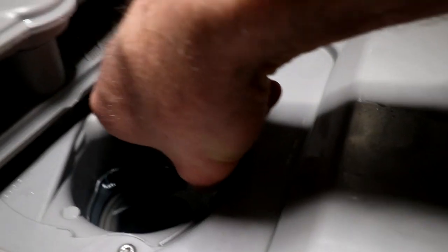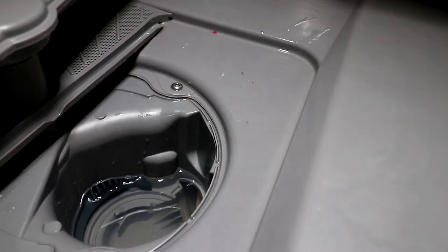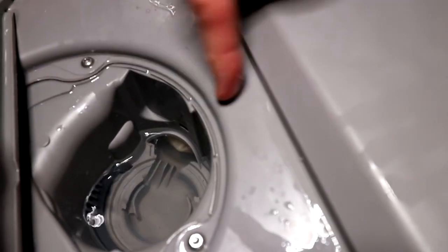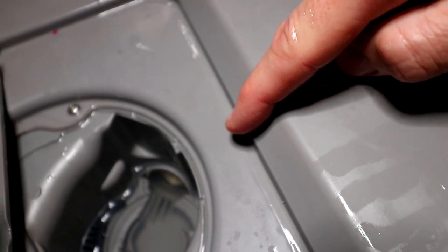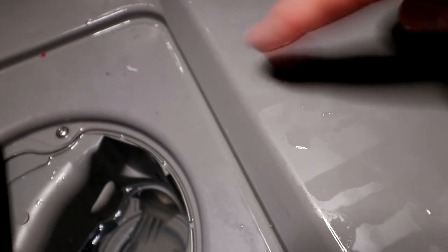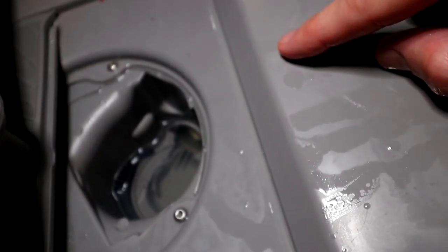What I did was I was able to run that piece of tubing just inside. If you put your finger in there — obviously with the power off — you can actually feel the outlet. There's a hole just in there, and I ran the tube — it goes this way a little bit, then drops down, then underneath the machine and out the pipe. If you put your finger in there or run a small rubber pipe, being very careful with the impeller, you can push a pipe through that hole and unblock anything there as well. I think there was a bit stuck in there, so yeah, that's that.